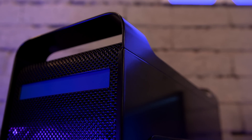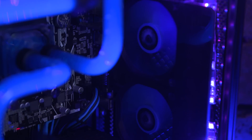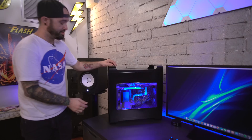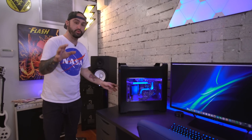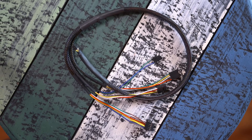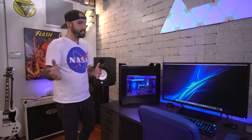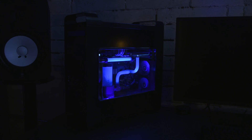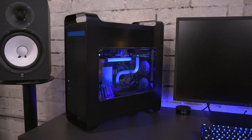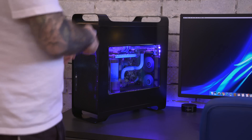I did retain a lot of the original hardware, such as the back fan mount on the case and also the hard drive bay which is behind this door here. I do have the original IO on the front which I'm actually a big fan of — there's actually a cable you can buy that will convert the proprietary connector on this front IO panel to an ATX motherboard. It's not cheap but it makes the power button work. You have audio output on the front and a single USB 3.0 port. The FireWire port doesn't work, but who uses FireWire anymore?